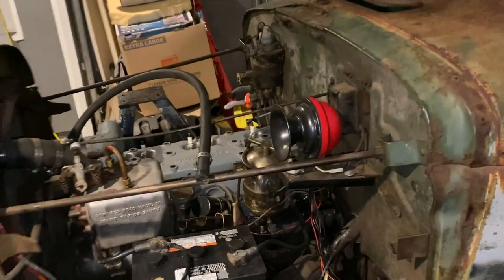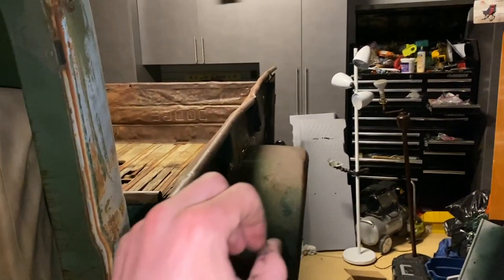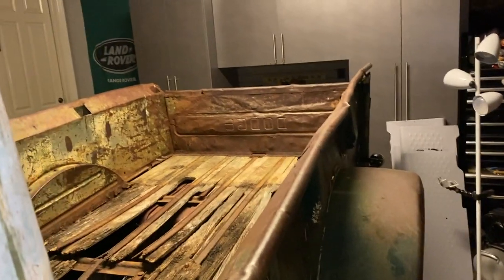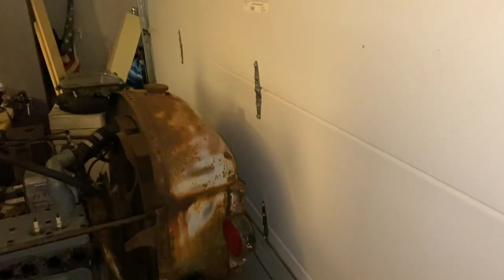That's pretty good progress for tonight. Tomorrow there's one wire left off this controller — according to the wiring diagram, that should go to the stop switch, which is basically a little thing in the brake line that detects hydraulic pressure increasing when you push on the brakes, so it lights up the lights in the back and your running lights get brighter. We also need a running light wire from the light switch, which will also control the big lights on the front fender. I'll try to do some of that tomorrow, but for now, I'm going to bed. Good night.